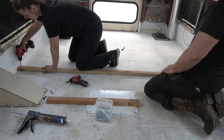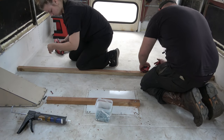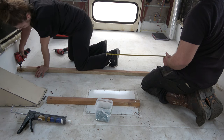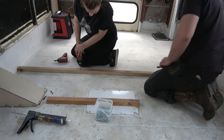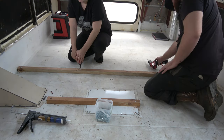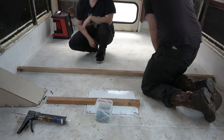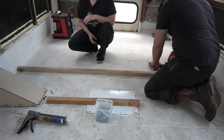And then we put the self-tapping screws, take those out, add some silicone, put the self-tapping screws back in, and then like I said earlier, you just want to make sure that with the silicone, no water is going to splash up or go through there, and we will be doing some adjustments underneath the bus to compensate for this as well, just to make sure that there's not going to be any water coming up through any of the holes that we have made. So you can tell, yep, I'm putting in a self-tapping screw right now, and then we're going to measure out, I believe, 24 inches from that, drill a hole through, get your socket with your impact, do your self-tapping screw.